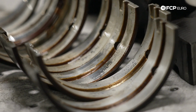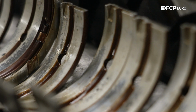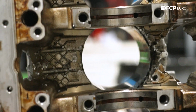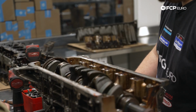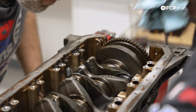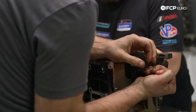I'm looking at the journal and I don't see anything that stands out as obvious, but now one thing that I do find very curious, this bearing journal compared to any of the other ones, you can tell how hot it got. Yep. You know, this backside here is almost black, whereas everything else has that nice chrome sheen that you're accustomed to seeing. Yep. It does.